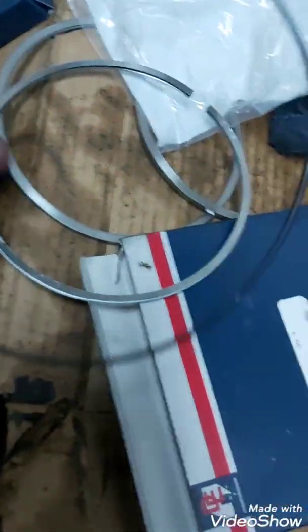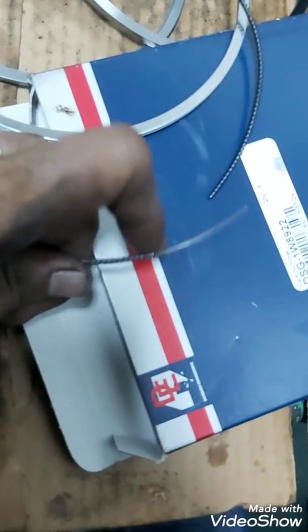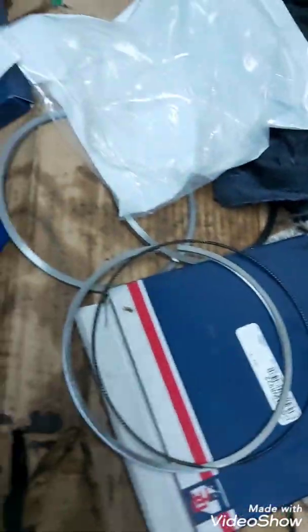The main thing I want to show you is that there is a yellow mark on the oil ring. I want to explain why there is a yellow mark. As you can see, I have removed the spring, and this spring is not in one piece. For fixing, we have to remove this, and then the yellow marking should come to the face of the opening of the piston ring.